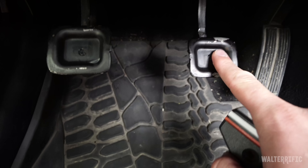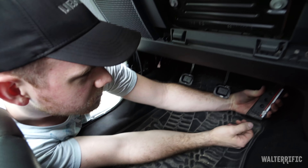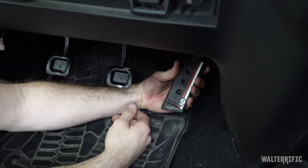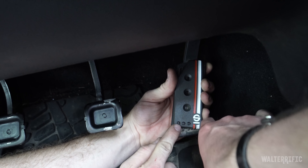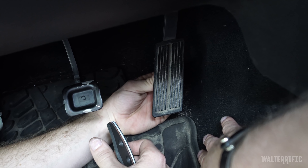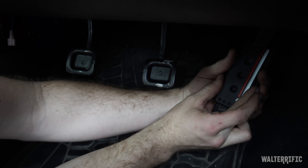Now we're going to try the pedals — failure could keep following us. We're going to cut the original gas pedal to make the new pedal fit on there, because it's a universal pedal and if you line it up, you can see it's not the same size. Worst case scenario, buying a replacement OEM pedal is like $60 — this one's $20, or the set of three is $60. So we're cutting to fit this one on and drilling to screw it in. How high do you want this? I think all the way up, because you use your toes to use the pedal.